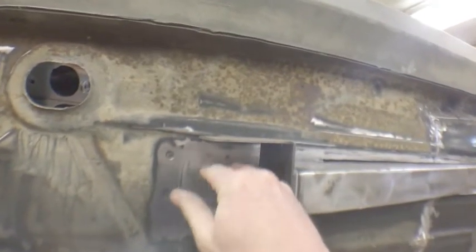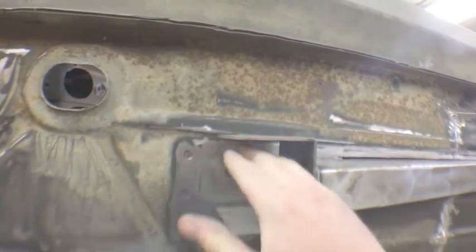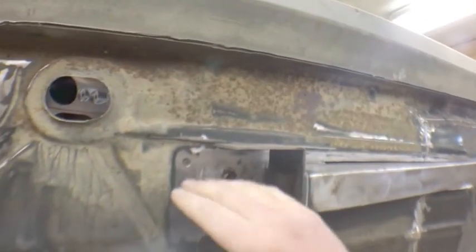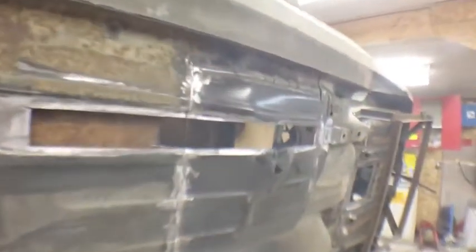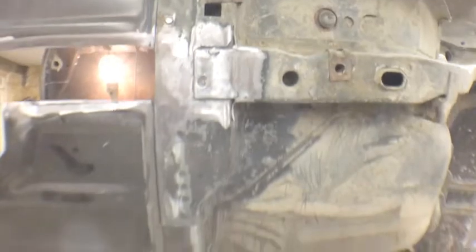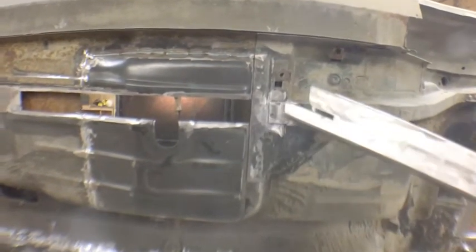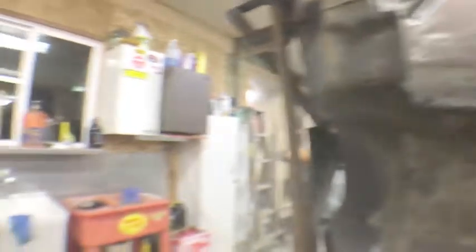The subframe is designed to move around in here to get it squared — perfectly squared. Before you use solid bushings, there'd be rubber bushings in here, but once this is set, it needs to be set. After this gets welded in, I'll have to square the body of the car up, and then these plates will get welded to the frame after the subframe itself is perfectly squared off into the car. I'll slide this out to show you — I just notched it back, and I went ahead and left the major steel portion that is in this car that the frame's welded to intact, and I actually notched the subframe connector to fit around it. The longer half is going over the top to meet the rear of the subframe, and the inner piece is going to come up around into the bottom of that.